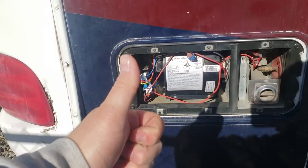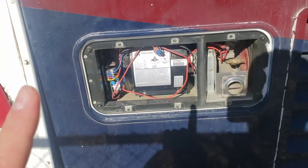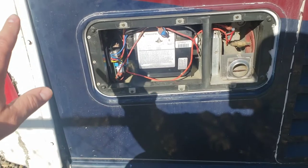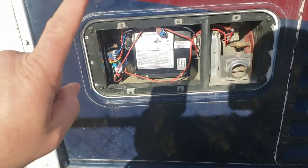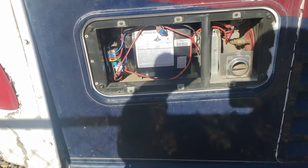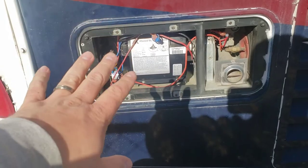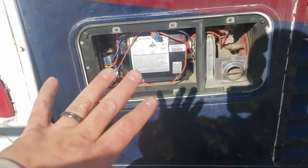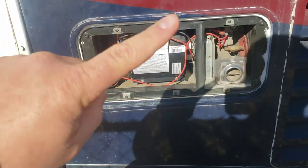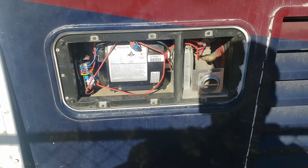Here's to another successful Dinosaur board fix. The furnace looks like it's working like it's supposed to. I may have another gremlin in that the blower motor is commanded on inside pretty much all the time — it was this way before, so it's no fault of the Dinosaur board. I applied power and the blower motor wanted to turn on and just sit there and hum. I think that has to do with the thermostat inside, so that one will require a little more research, but I can work around that in the short term.